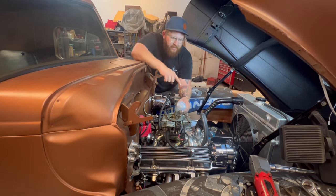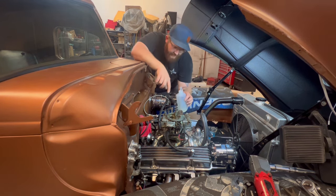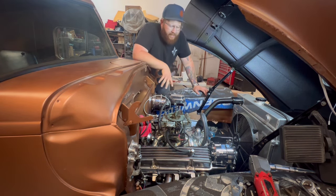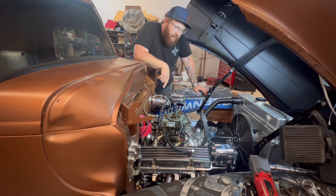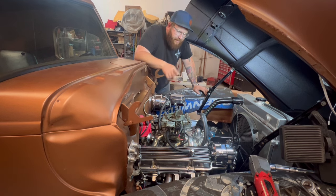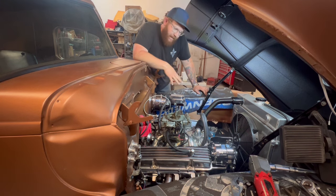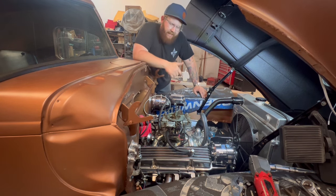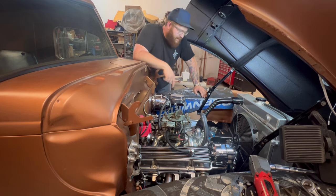I want to start this and just make sure the push rod length and all that's correct, because it sounded like we were making a little tink tink tink noise, and I'm not sure if it was because we were backwards on our timing or if it was because we had a push rod distance problem. Super simple to check, just two bolts, disconnect that, try it again, see how it runs. Runs good, then it's that. If it doesn't run good, still makes the same noise, I'm going to say we're 180 out. I know this engine didn't have any noises prior to this, because this engine used to be in my 52 Ford truck. Now it's in here because I didn't want chrome and he did. So we're gonna test it out now.